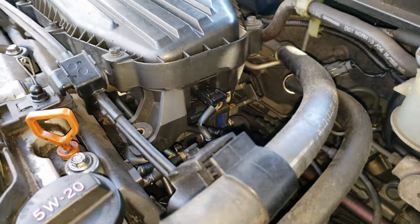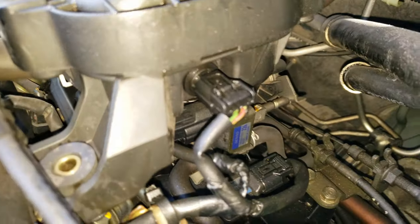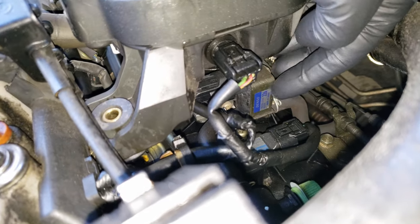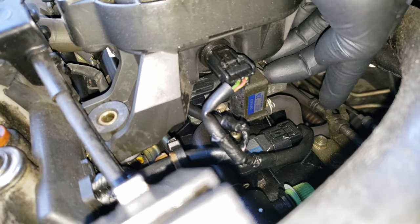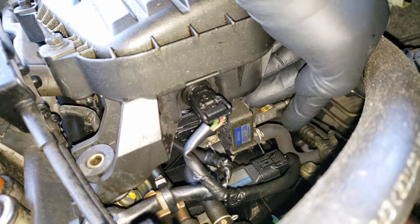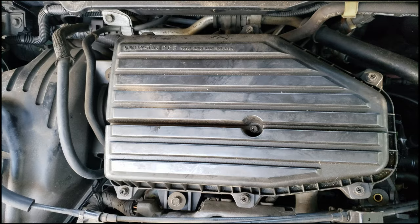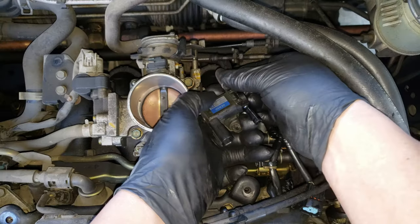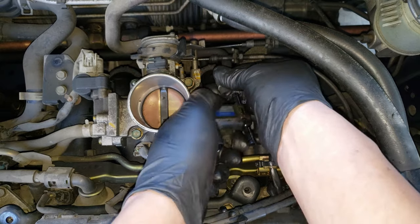The one clue I have to go with is that this car has not been running as good as it was before. When a car has a rough idle and an evap code, there's a pretty good chance it may be related to a problem with the purge valve leaking or stuck open. I'll be removing this to test it off the car, but for this video I'll skip the detailed removal since I'm suspecting this piece is bad and I'll leave the removal process for the next video — and if I'm wrong, why show it anyway.